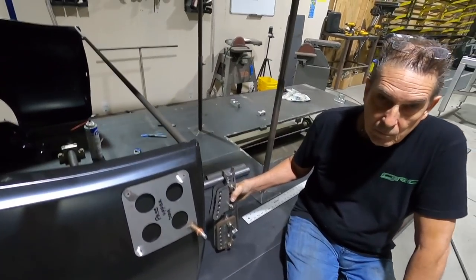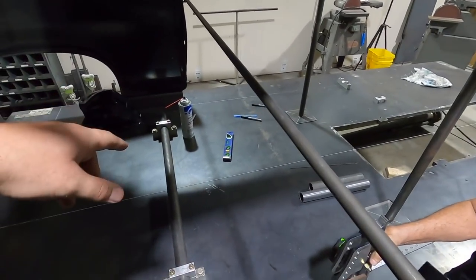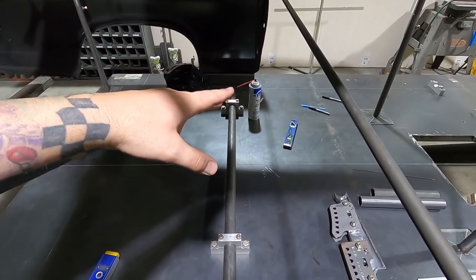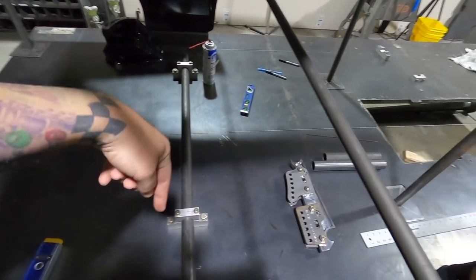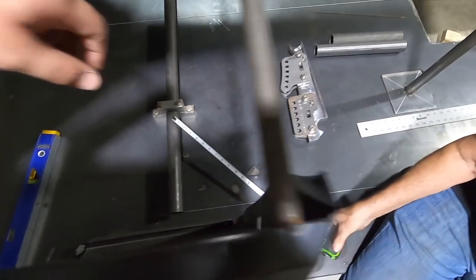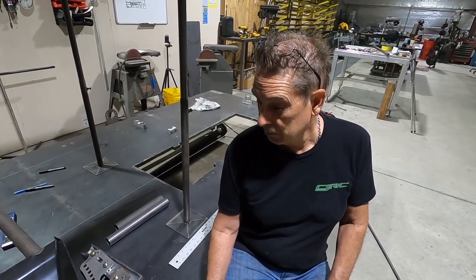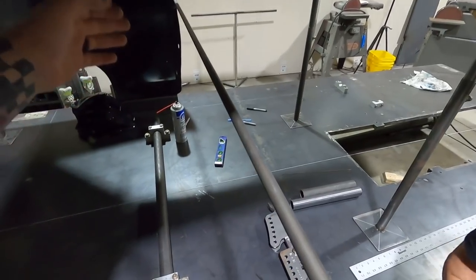That's probably the most important thing when moving the body front to back. Danny's got it set side to side and front to back, so he's ready to start with the cross member. On the cross member, we bend a 90 on the driver's side so the seat can sit below it if needed. On this side we do about a 10-inch setback — this one looks to be about a 40-degree angle. The angle changes per car depending on how wide the car is.